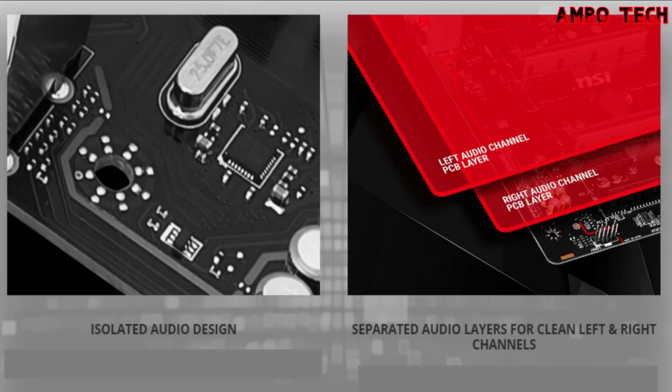The isolated audio signal has an isolated audio design and separated audio layers for clean left and right channels. With the isolated audio design, like a dedicated sound card, audio components and circuits have been laid on a reserved motherboard section and electrically isolated. The separated audio layers use separate layers in the PCB, ensuring equally pristine sound quality for both left and right audio channels.